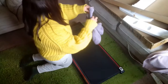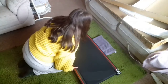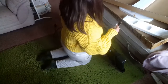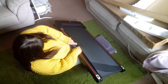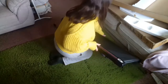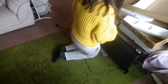Although they're quite heavy, you can stand them up on their sides and they also have wheels at the front so you can wheel them into position. I'm going to put the oil on the belt first — I'm putting a mat down in case I drip oil on my rug. They say you should lift up the belt and put the oil in that way, but the belt's quite tight and I didn't want to fiddle around with it too much, so I decided to tip the treadmill on its side and drip the oil down into the gap on both sides. You don't need much, and you're not supposed to do it too often, but it helps lubricate the belt and help it run properly.